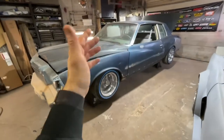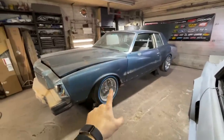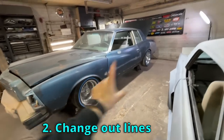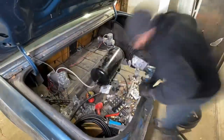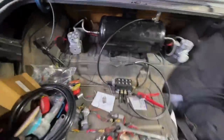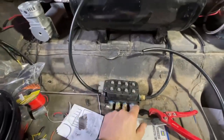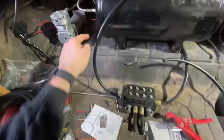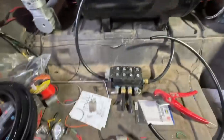I'm not even going to hesitate, I'm going to go change out all my fittings right now to half-inch lines. After I get all the fittings changed out it's time to change the lines — this still has the three-eighths lines coming off the bags going to the back. We need to drop these wheels down and change our lines out. Got it done — check it out. I went ahead and have two inlets now instead of just one, so basically double the air can get in and out.